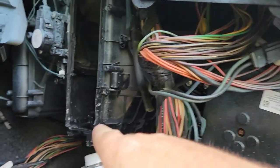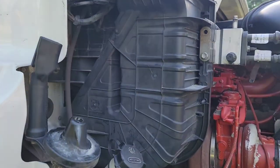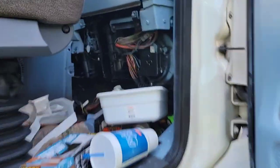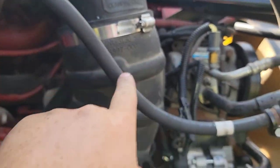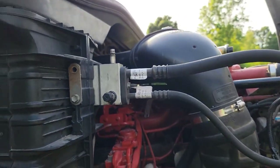I eventually decided to try to find the leak. The reason it was leaking up here is because it was angled down and there's a pipe that runs out behind the box. You gotta take this whole box out and take this off - it's a lot of work. But yours truly took that box off and broke the new evaporator coil. I put too much pressure on these lines which run back to the coil because I didn't take this piece off first to let the box come straight out.